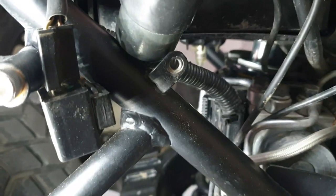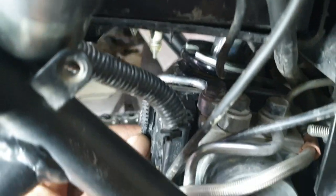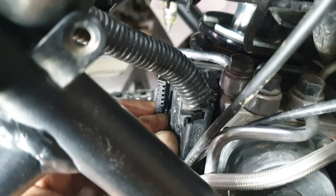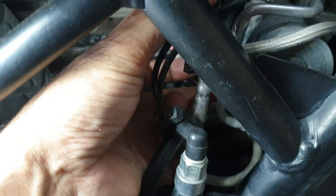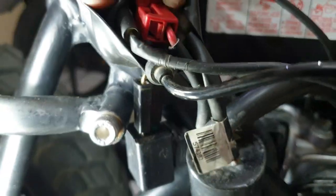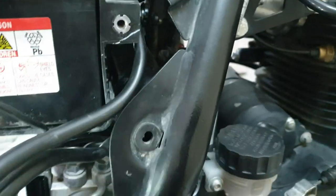Let's open up the connectors on top — this one and this one — before moving ahead. This is where your ABS unit is, that's the Bosch ABS unit. There's a tiny tab here — you press it, then from the rest of the fingers you pull it down like this, and that wire is free. The rest of the wires are pretty simple — just pressing the tab.